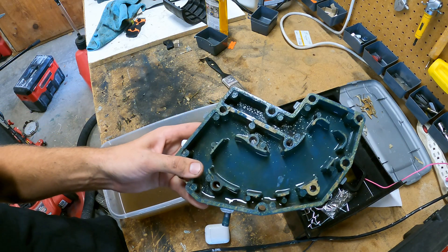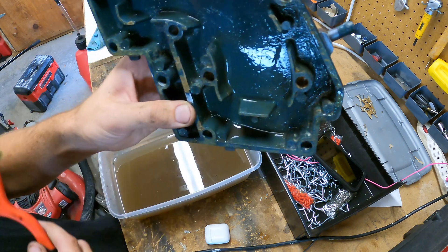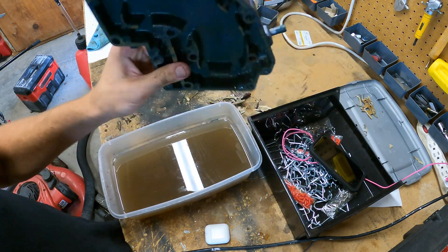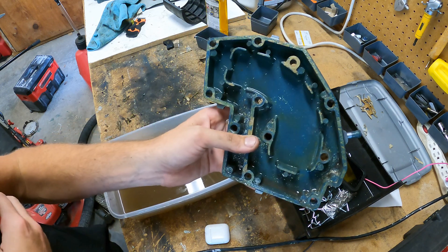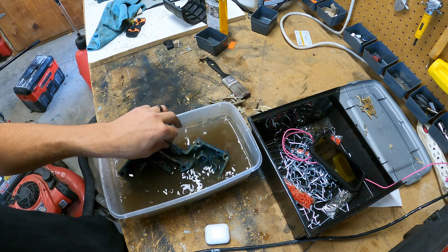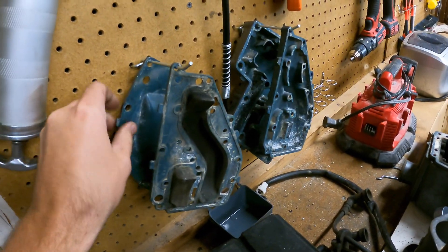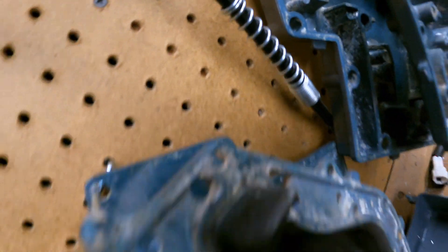This has been an incredibly tedious project. I'm still just trying to get all the corrosion out of these little spots. I can't be too OCD on this, but I'm worried that one little piece of corrosion could block the cooling system. Once I get this thing back together and as clean as possible, I'm going to run the ski hard and pump water through it for an hour or so at full throttle. I've been dipping it in vinegar - it's been sitting in there for about eight hours, then I take it out and use a brass brush. The water box parts are about as clean as I'm going to get them - they look a lot better than what they were.